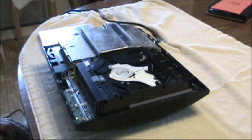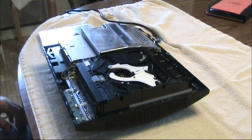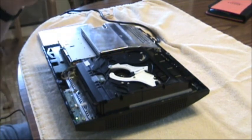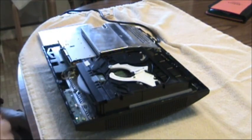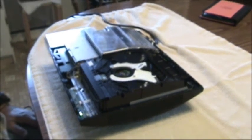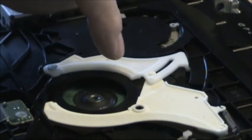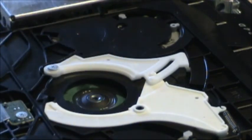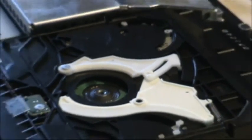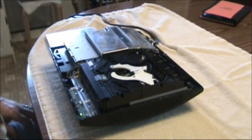Let's turn the power on. Let's remove this little disc magnet. I'm going to insert a CD and we're going to see if the spindle is working. As you can see, the disc is not turning — it's free but it's just not turning. So we're going to attempt to change the spindle and see if the motor is the issue. The eject looks pretty good though.